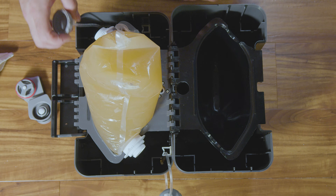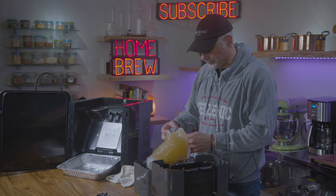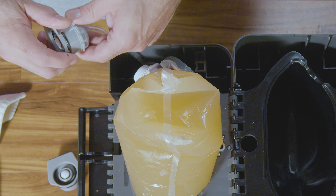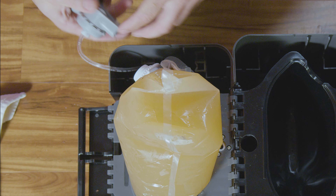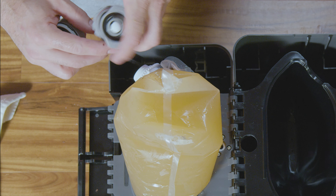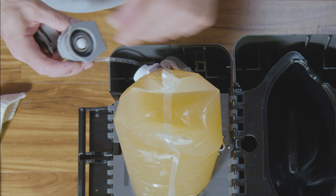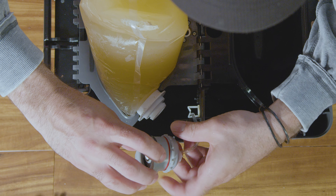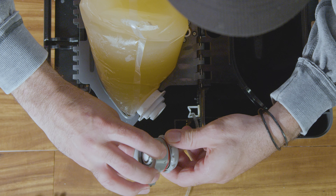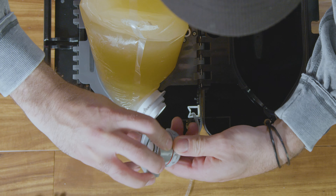Make sure that none of the hoses are pinched. These are the valves with the red gasket on them — they get screwed on like this, nice and tight, really snug. Make sure that red valve isn't poking out or kinked in any way. You can see all the way around that it hasn't. Do the same to the bottom — almost makes sense to go backwards so you hear a click because you don't want to cross-thread that. Then just turn it and give it a nice snug fit.